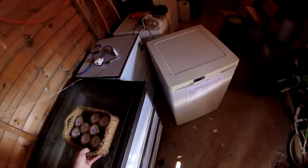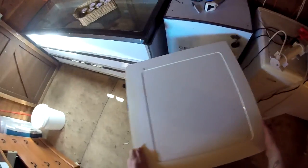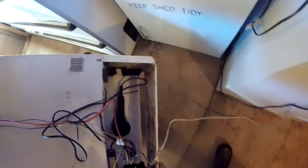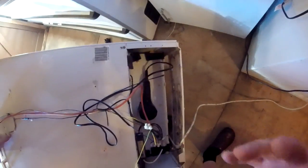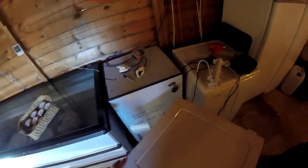Right, we're back a couple of days later. We trialed the food dehydrator and it wasn't quite getting up to temperature with the 60-watt element in the bottom. What we've done — not everybody might agree with this — is block the top hole back up again as there was too much ventilation. At the bottom I've now got a 1200-watt travel hair dryer wired into the circuit, and its thermal cutout has been bypassed.